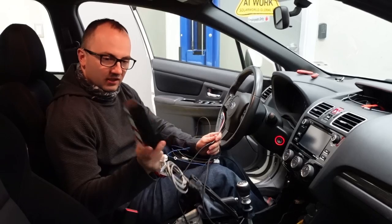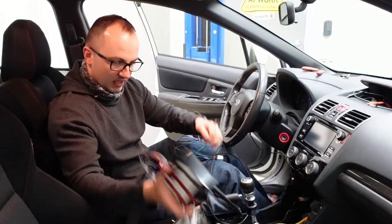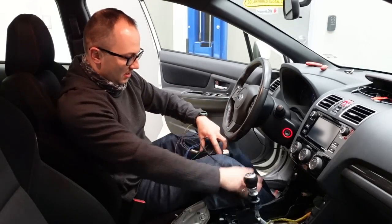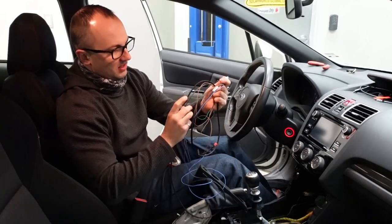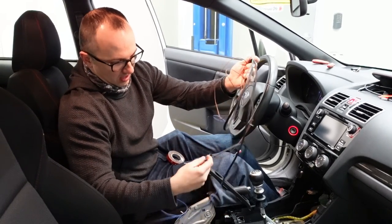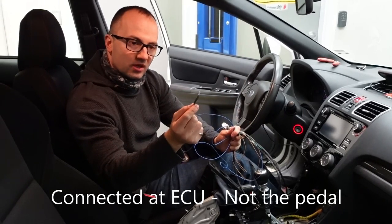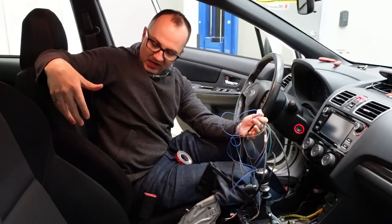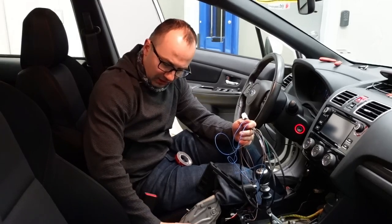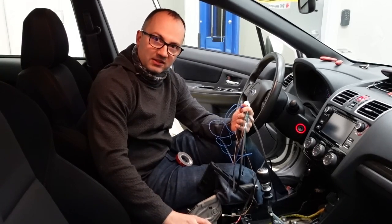The controller is a pretty plain box with the accelerometer attached and a couple of connectors to plug into the harness. From the transmission side there's a three-wire connector that drives the DCCD solenoid. The harness connects a ground, your e-brake via the brown wire, and your accelerator pedal position — we're grabbing that from the pedal in the 2018 WRX. We're mounting it inside the center console — we found a really good spot right behind the rear cubby — and putting the accelerometer in the center so it accurately picks up the yaw of the car.